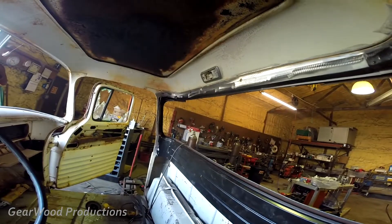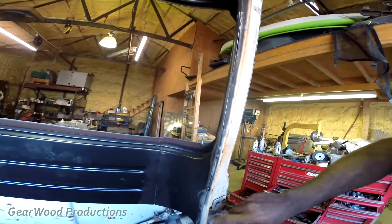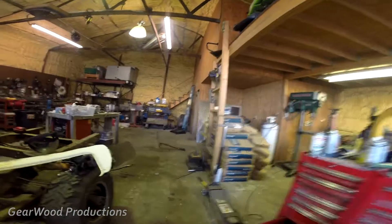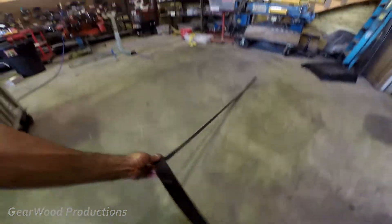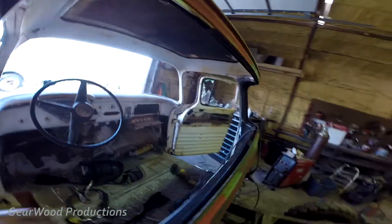The frame is just tacked in there. As you can see, I had to cut some metal because I wasn't ready to take off the metal surrounding here — which is this stuff. So I trimmed this piece of metal off the inner panel for the big window truck. Here's the original one, and now this is the replacement big window one compared to the small window. It's tacked in — I did trim around there and also here, that's what you see over there.